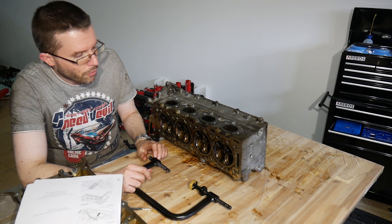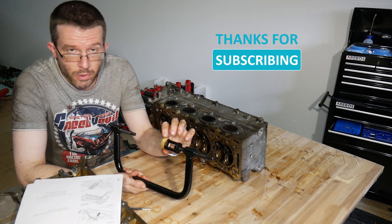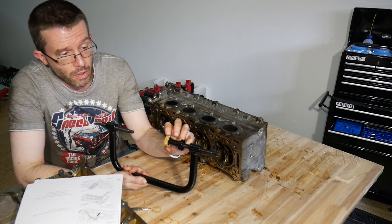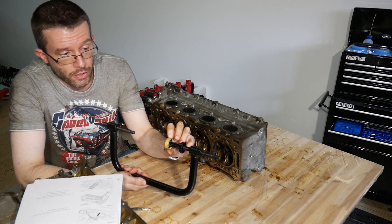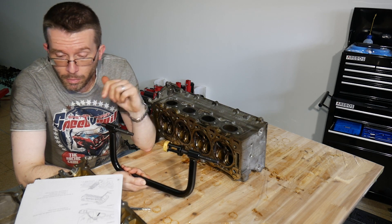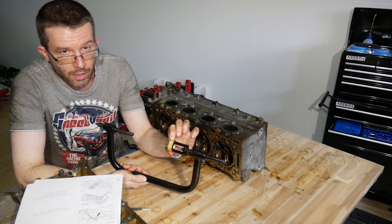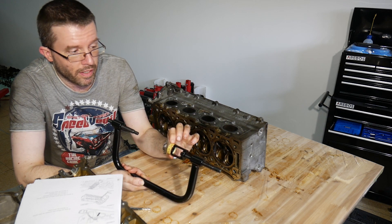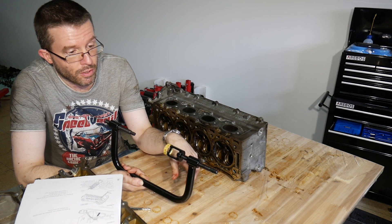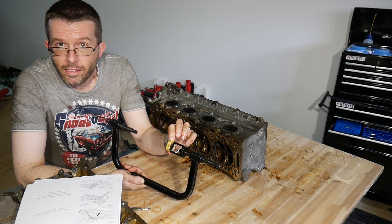All the valves on the A-bank cylinder head are now out. I'm quite satisfied with this universal tool, with one exception — it's not sitting 100% square on the valve spring retainers. The metal is bending and the adapter is oversized: it's 28mm diameter while the retainers are 25mm. The next smaller adapter is 23mm and doesn't fit, so the retainer slides around and tilts when I push it back inside. That's why there's always a nasty noise when trying to get the wedges loose. Wiggling helps take the tension out — I can live with that.